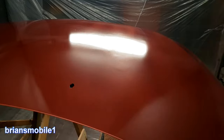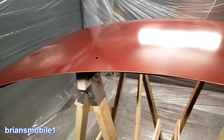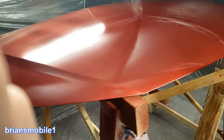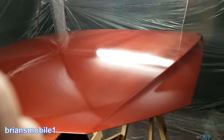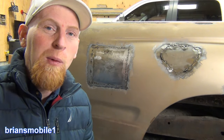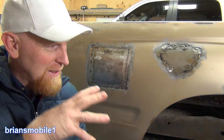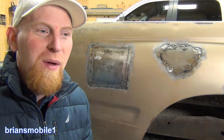The more I look at this horrible body work, the more I'm like — don't quit your day job, good thing you're a mechanic. For how much work I put into this, it turned out terrible. I did so many different passes of glazing putty, so much sanding, and it's still just so bad. This product uses a UV light and it's transparent — a translucent glazing putty where the light travels through it, so the UV light gets down to the bottom, sets it, and then you can get right to it.